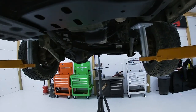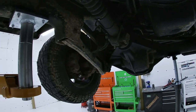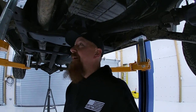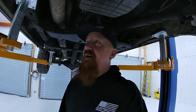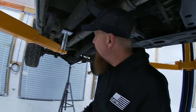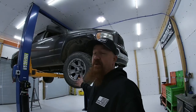I want to get used to where the lift points are for every vehicle and what kind of adapters to use - that's part of figuring it out. I spent some time before lifting this truck testing things out and figuring out my weight distribution, what I can safely lift on, how many block supports to put under it, and getting everything good and straight underneath the frame.